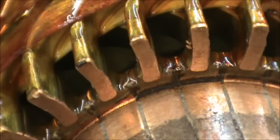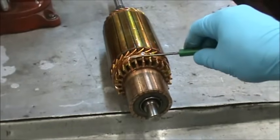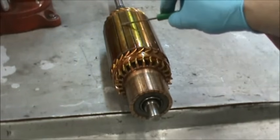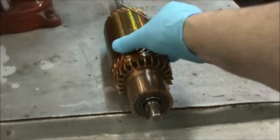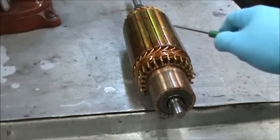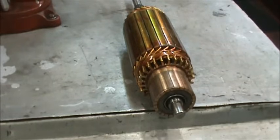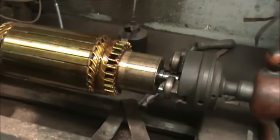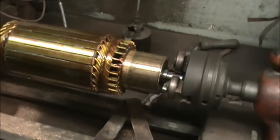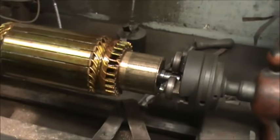This one is in condition that would be considered fine. Make sure nothing is raised up and burnt along these bars. Sometimes when you have to jump them with jump equipment in cold weather and they spin real fast, they will fly open and you will see burnt marks. If you do have a lathe or access to a lathe, you can always file the commutator down to smooth out any pitting or scratches. You can see where we recommend the tail stock to be chucked up.